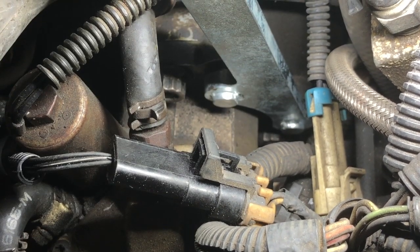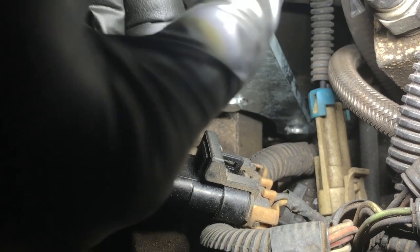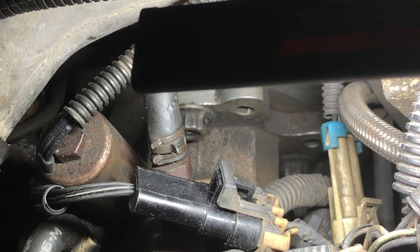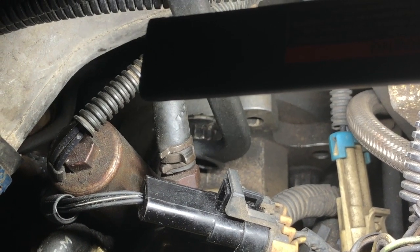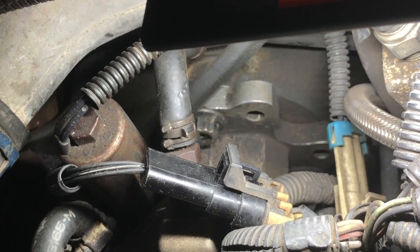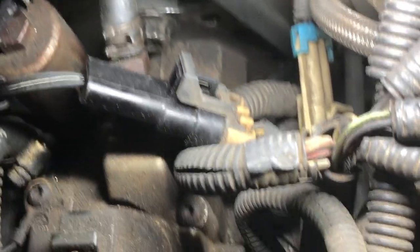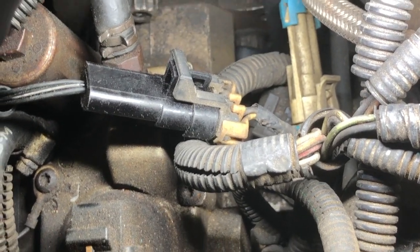Before we get into this, let's review the documentation one more time. The spec is negative 0.75 rather than negative 0.70 as the outside range — we're trying to get into between negative 0.25 and negative 0.75. These are the factory specifications. We're redoing this after the crankshaft position sensor repair to account for timing chain wear. If the value isn't within that range after the sensor procedure, you continue to the next step, which is adjusting the injection pump itself.